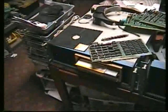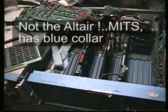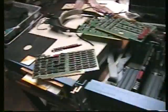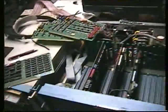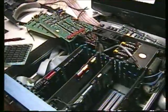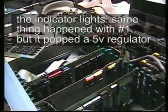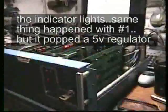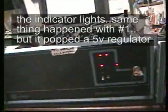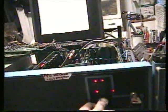I'm trying that disk drive there, the Altair. Comes on and everything. Seems to try to work, but anyway, this thing. So I turn it on and I get that — all the bus lines are high, all the data lines are high, all the front numbers, the indicators are on. Reset. Won't do nothing.